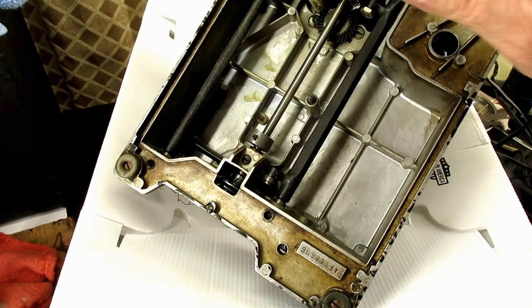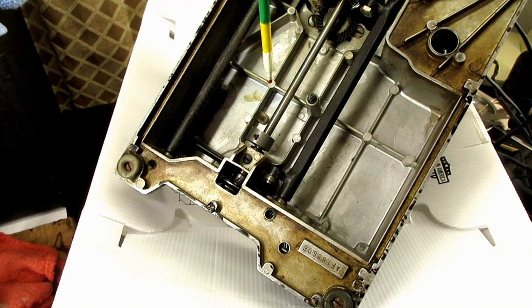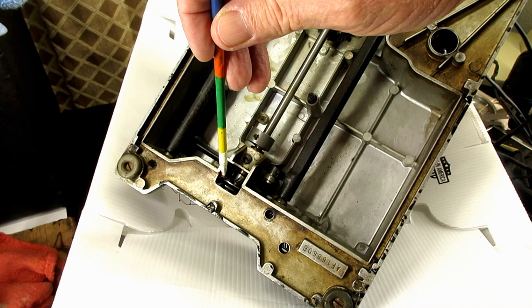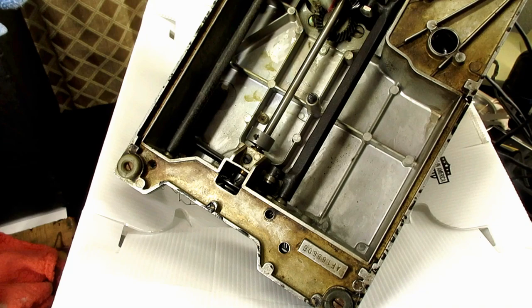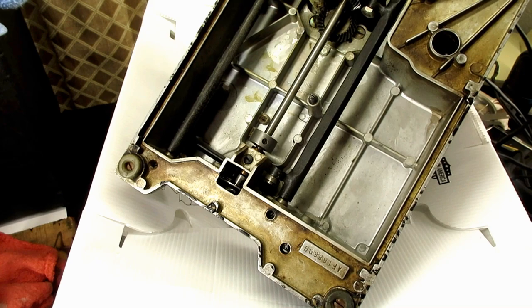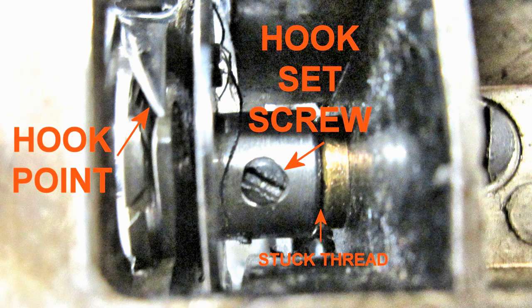I just have Lala set upside down on an upside-down packing box. Down in here you'll see the hub of the rotary hook. And you'll see a loop guard. And then on the other side of the loop guard is the hook itself and the hook point. There are two set screws that go through the hub and up against the hook drive shaft, and that's what we want to take out down there.